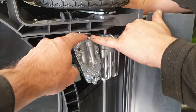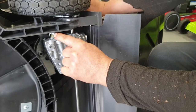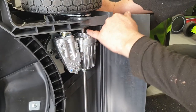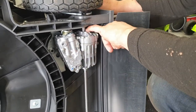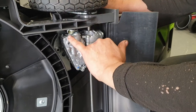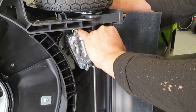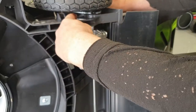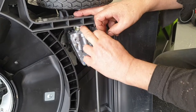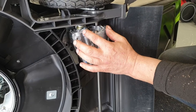You can either access them through the little screw here at the top and there's another one around the back. So over time they will lose fluid, coming out around the axle, around the seal — it's the only place they can come out. So they periodically will need topping up with fluid. The easiest way to do it would be to take the wheel off, drill an access hole through there, undo that, and then you can just slowly leak fluid in there.